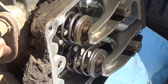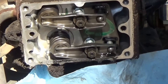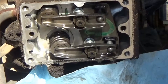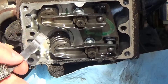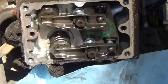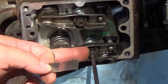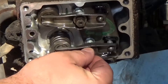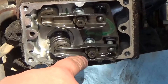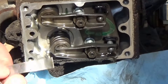So let's go ahead and adjust the valves. We're going to need to turn the motor over — whichever valve goes down first, the exhaust going all the way down, you want it to be about all the way in as far as it goes. Then we are going to adjust the intake valve. So now release the T20 Torx bolt in here, loosen that up a hair, and now you can grab the outer bolt and use it to adjust. You could put a wrench on there — I think it's about a half inch — but it never needs it when I do it.